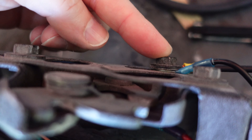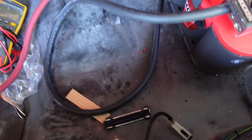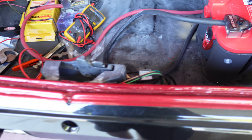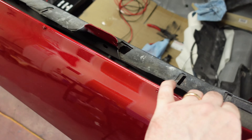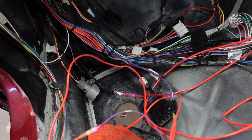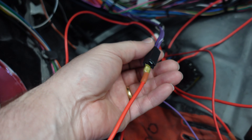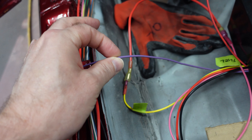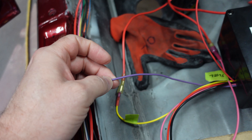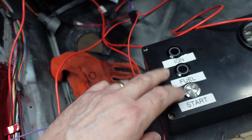I'm not sure where the ground goes — I can't find my painless manual, I'm going to dig it up, so I just stuck it right here for now. Stuck the battery in the trunk; it's just sitting here with these big kicker connectors on there. Tested the fuel pump — fuel pump works. Tested the starter — starter works. The neutral safety switch is right here and it goes directly to the starter on one side. I basically looked for which side had some resistance to ground, which was this side, and connected that straight to my little test jig. This is only 18-gauge wire; hopefully that's enough for the juice for the solenoid. It was okay for the little test but I've got to keep an eye on that and make sure it doesn't get hot.